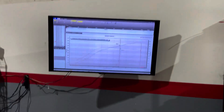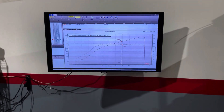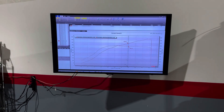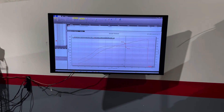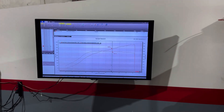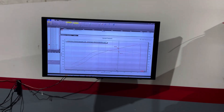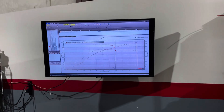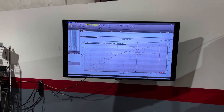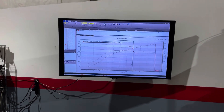First pull — it's a little shy on ignition timing, I didn't go crazy with it yet, and I cut it short just to be on the safe side to go check out the data log. But as you can see, we're already at 533 horsepower and 400 foot-pounds of torque on 22 pounds of boost. Look at that — 7,700 RPM. So we're just going to go up slowly and see how she does little by little. Very very excited with the results. She spooled very clean — spooled by 4 grand, hitting 350 foot-pounds of torque at 4k.